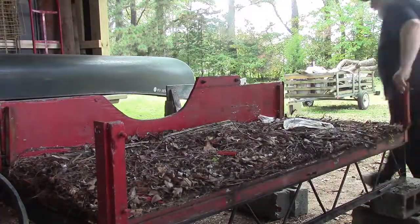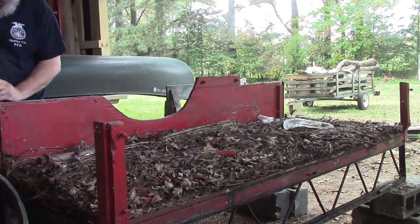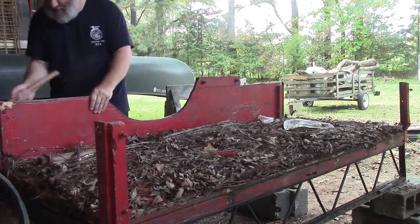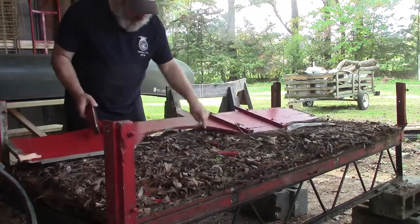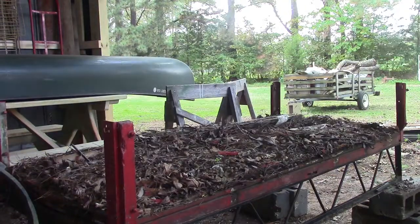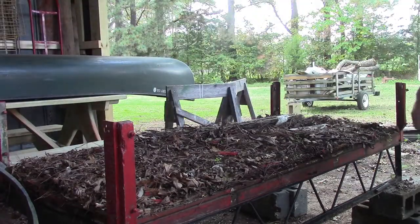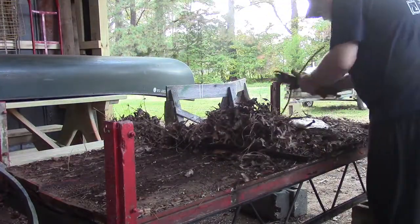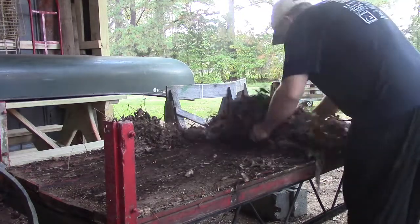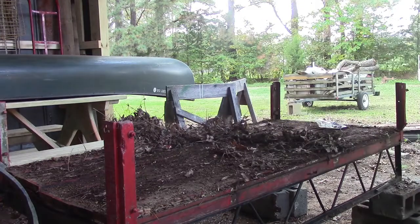As you can see here, I'm trying to do my final sanding and get all the rust and debris off as I can. If you want the best paint job, you should go over this with some brake cleaner, spray it on and wipe it off — it will actually evaporate into a perfectly clean, oil-free finish. Even the oils from your hands can affect your paint. I didn't have any the day we did this, so I sanded it and wiped it down with a clean shop rag, kept wiping until my shop rag stayed clean basically, getting off all the extra debris.